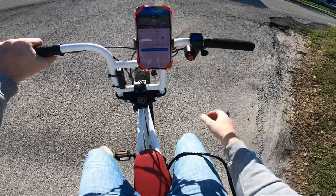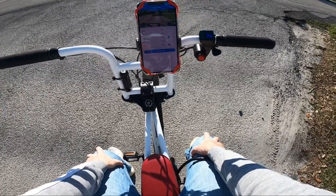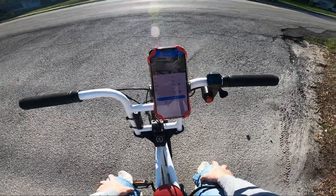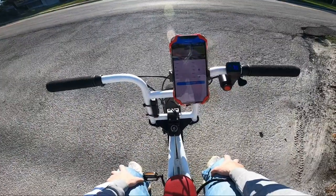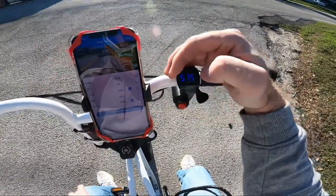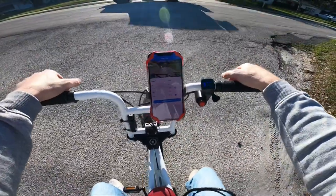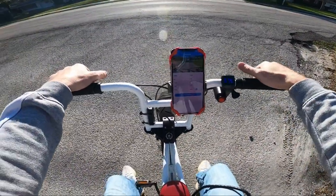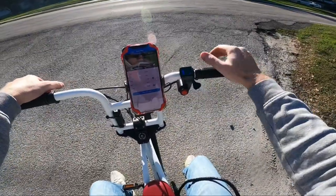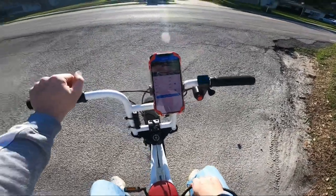So, that's what it looks like. A 33 second quarter mile, 3.78 60 foot. I don't remember off the top of my head the other one, but we'll be able to compare that data. For reference, we're down to only 57 volts. This pack has a lot more batteries in it. It's a 5P pack, with Samsung 30Ts. So the voltage is going to stay up, whereas in the other pack it was dropping off.